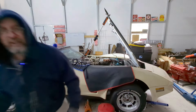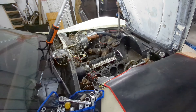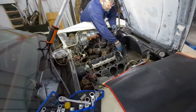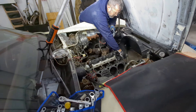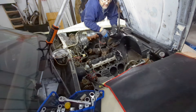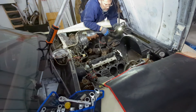You didn't get to see me fall. I think it was a good decision to take off the whole front area because I'm looking at the timing cover and it looks like it's leaking right at the very bottom, right where it and the oil pan come together. So if I had replaced the oil pan, put this whole thing back together, and it was still leaking, I'd have been a little upset. Might as well go through this pain in the ass process just so we don't have to go through that later.